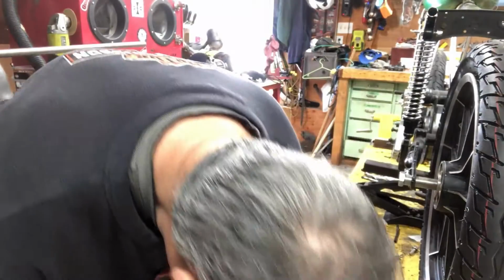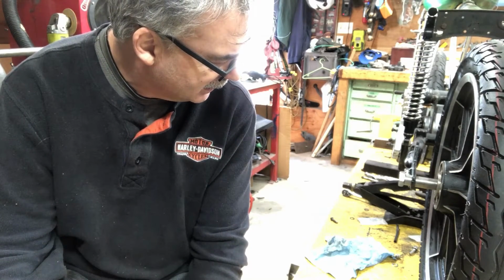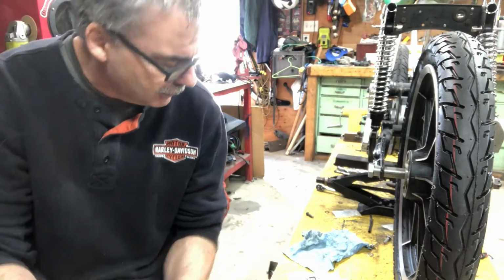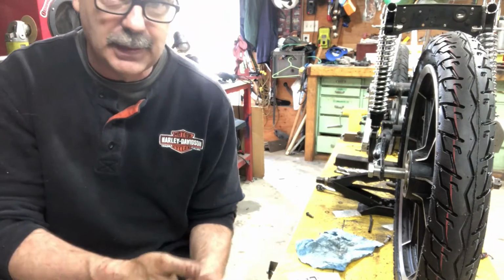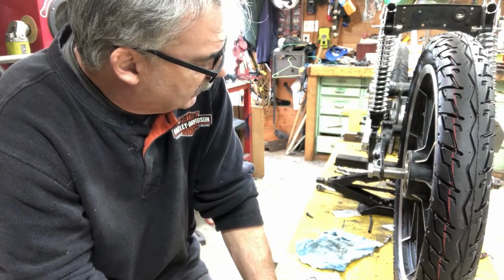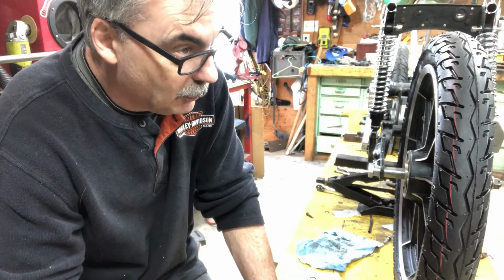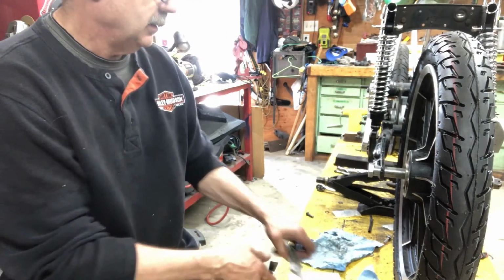I gotta convert that 50 thou to metric. Okay. So I just asked Siri, and 39 thou is 1 millimeter. So say 40 thou. I've got 50 thou clearance here when this is loose. So I could add 40 thou to that spacer. Make another one, third one. And that would give me the 1 millimeter I need.